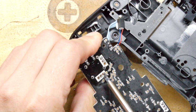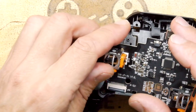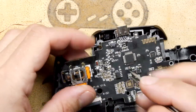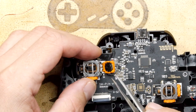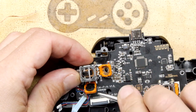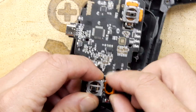Nothing is jumping out just yet. I'll turn it over in a sec just to make sure there's no other mechanical means these are held in. So we've got a couple of options: either we keep probing and yanking on it till something happens, or - which I think is the better way - we will destroy it further, and that will help us. This was really interesting, because you can get some repair parts for these and actually just change the potentiometer innards. Some people bend them over, change that inner part, and put it all back up. That has the benefit that we can now just work on that little three-pin device on its own, rather than try to bring out the whole thing as a module.